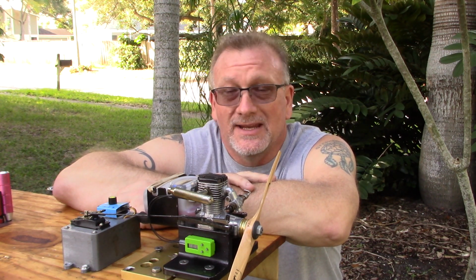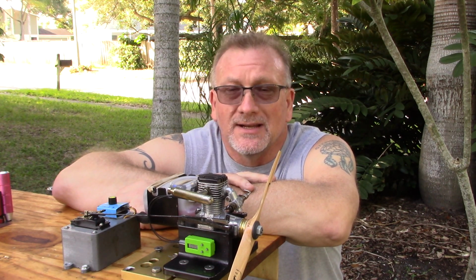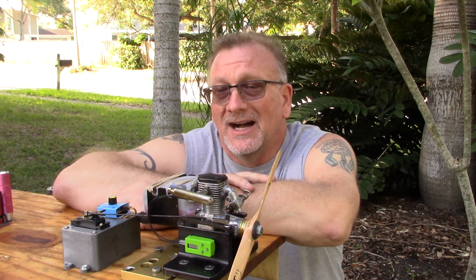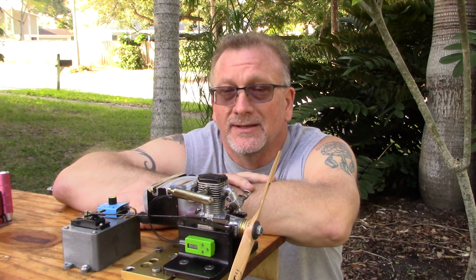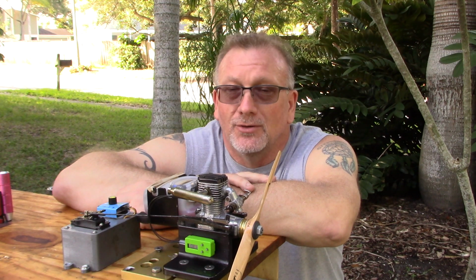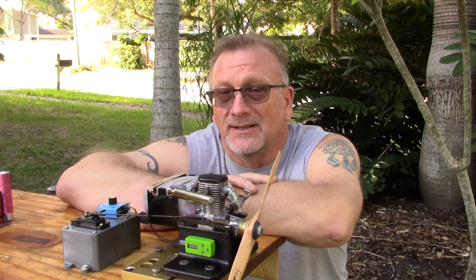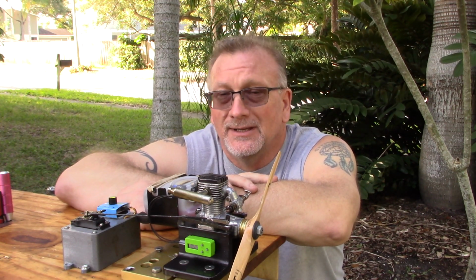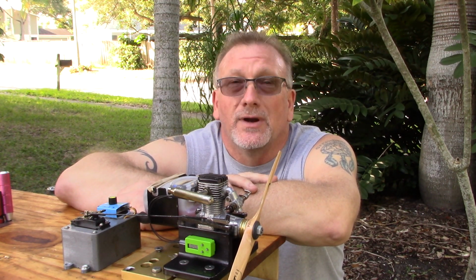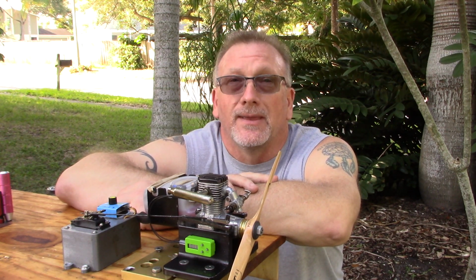This one just doesn't make any goddamn sense at all as to why it won't idle down and why it sounds like shit. No matter how much I lean that low speed out, it doesn't change. It always sounds crappy. It won't idle below maybe 4,500. And this is not a new engine. I bought it used. I've probably run this thing 25 times now. Nothing has ever changed. Nothing.